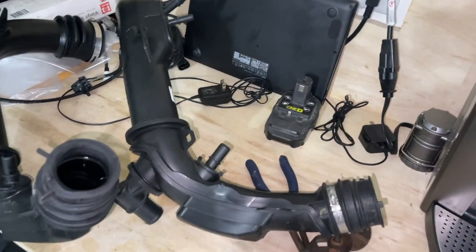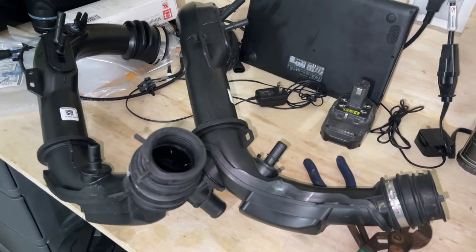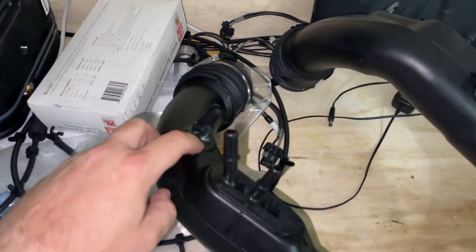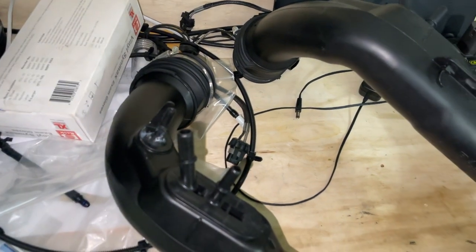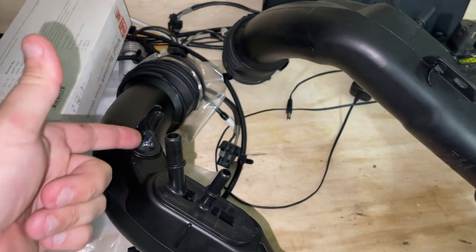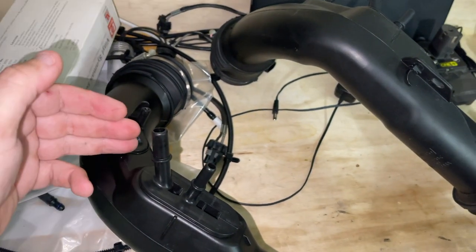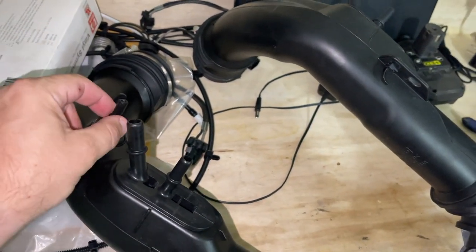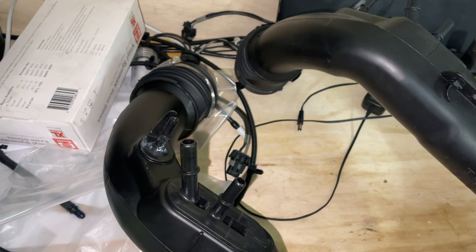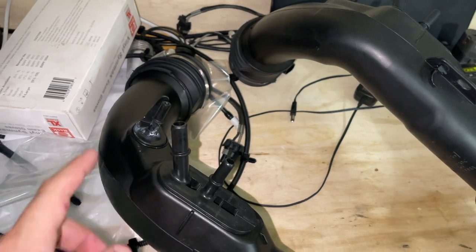I want to go with the one made for the 2022 instead of capping off the old one. I've ordered fittings for the two different intakes made for this fitting — I'm going to try to drill and tap the factory tube since it's pretty thick plastic. If I can drill and tap it and put a metal fitting in there, that's a viable fix for under 20 bucks, from either FinFab or AWE or AFE Racing.